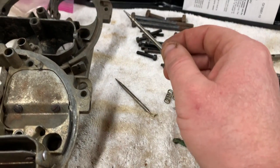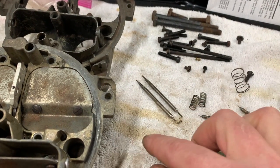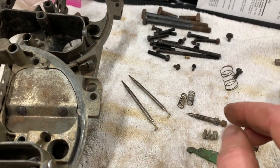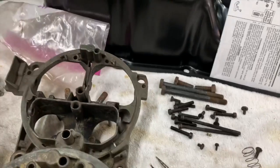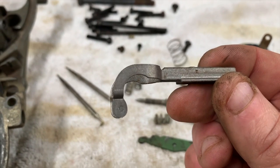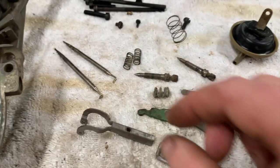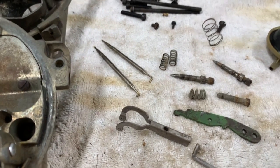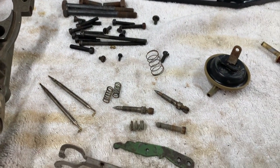Here are all the remaining parts for the carburetor. The Stage 1 '71 Stage 1 has AV secondary metering rods - these are the original ones out of there. The other thing was the K hanger right here - you can see the letter K stamped into it, which tells you how high the hole sits up in the hanger itself. It was completely rusted out so I ended up getting another K hanger, but it's going to be essentially the factory calibration - that's what we're shooting for.